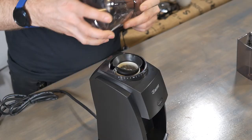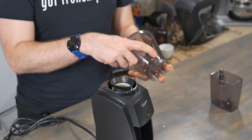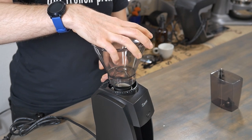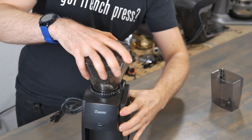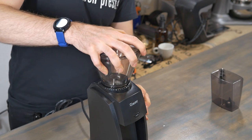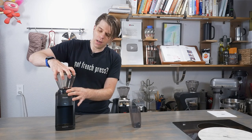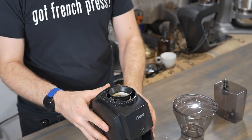Once you've done that, take your bean hopper — make sure it's empty of beans because it's going to be a lot easier. On your bean hopper, you'll find a white line, which is what you use to set your grind level. Take that white line and in order to place the bean hopper, put it just a little bit past the 40 mark. Press down until you feel it lock into place and you can hear that click — that means it's in place. The gasket will not go anywhere now. But keep in mind you're going to have to take your bean hopper off from time to time to clean your burrs and bean hopper, so you'll end up having to move this gasket from time to time.